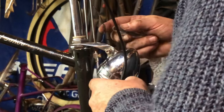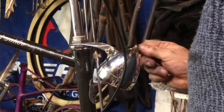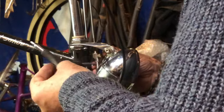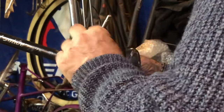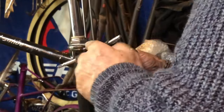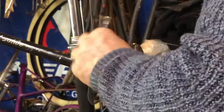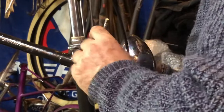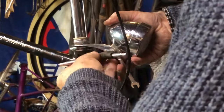You'll be able to see the wire coming out of the steerer tube here, it's just been wrapped around here ready to plug in. I'll do that when I've got the lamp on - in fact I'll do it last, because I'll obviously be wiring in the rear lamp as well, putting the LED in it. There will be faff and fiddle - there always is setting up dynamo lights. I like dynamo light sets but they are a faff to set up, and I don't like messy wiring - that's why I like these bikes with concealed wiring.